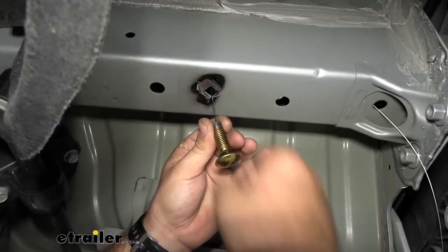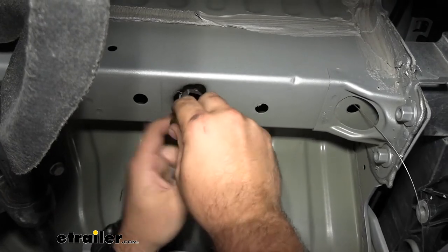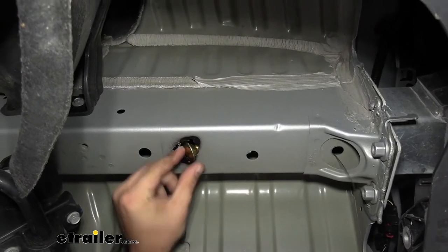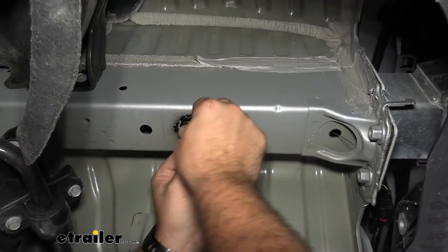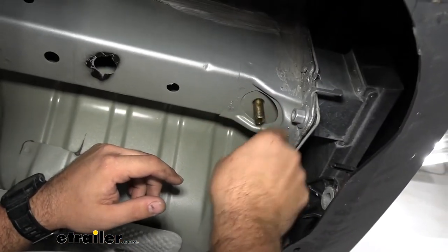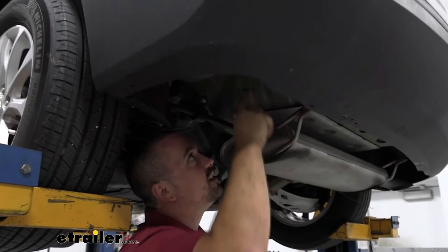Don't pull the wire down too much — make sure it doesn't pull through, and if needed put a little bend to keep it in place. The spacer block may cause the carriage bolt to sit a little crooked, so if you're having trouble you can also pass it in backwards — as long as it gets into the frame rail it doesn't really matter. Keep the fish wires on, as it'll be a lot easier when you put the hitch in to prevent pushing these back up into the frame rail. Repeat the same process for the other two holes and the three on the other side of the vehicle.